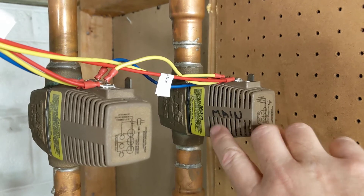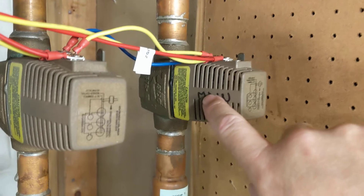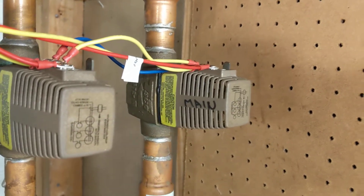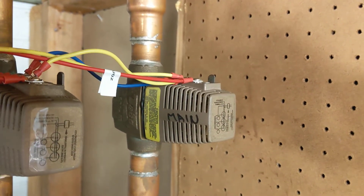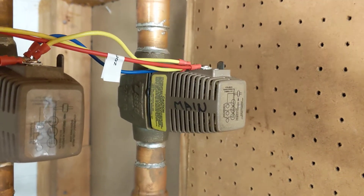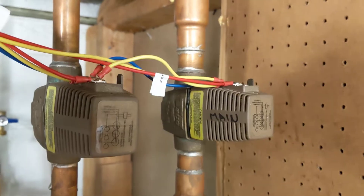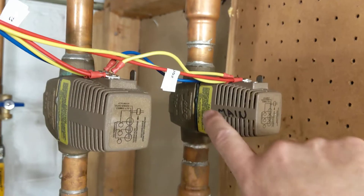In normal operation, there's a heater element inside that's heating grease. When the grease gets hotter it expands and moves a piston inside, which closes the switch — lets the contacts of the switch come together. That takes time, about a minute, and it's silent. You don't hear anything happening. But when the piston finally extends and the switch makes contact, the circuit is closed.